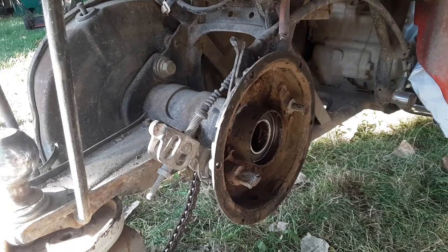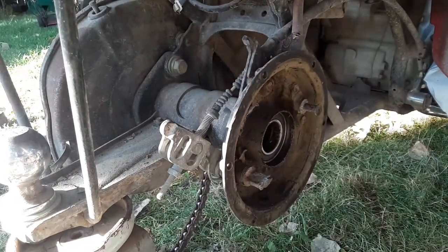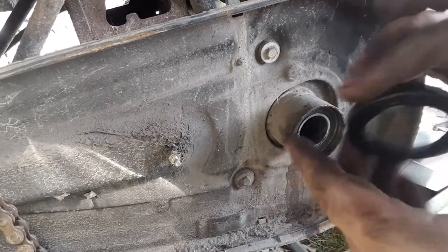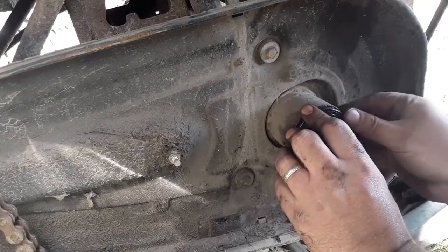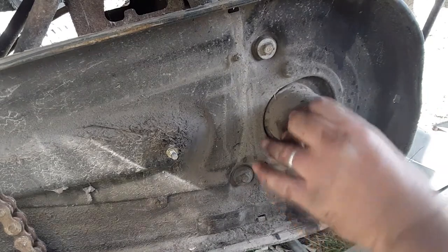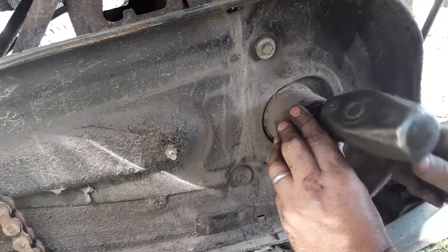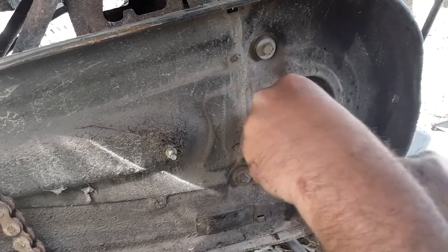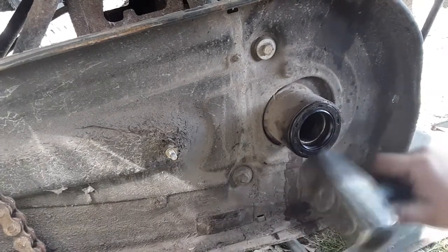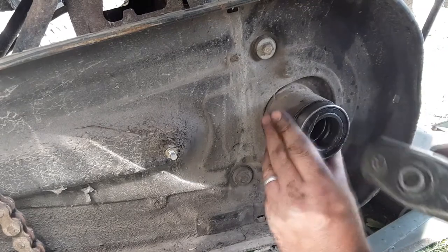That's how I'm going to do it. I'll do the other one off camera without you guys watching and critiquing me in the comments. Okay, I got this one in. Now I got this little seal - there's a tiny bit of grease on it, probably greasy enough. I'm trying to press it in by hand. Maybe if I use this old bearing - that's a way too big hammer. Wait, I'm going to start it square. Oh it worked! Now let's take the bearing and really waylay the seal - all the way in.